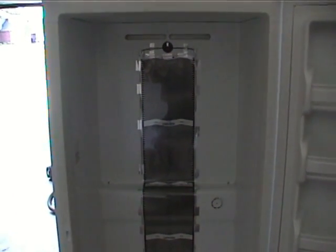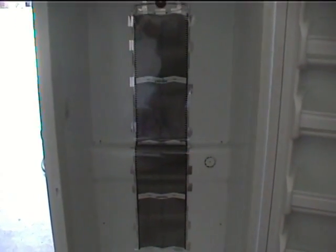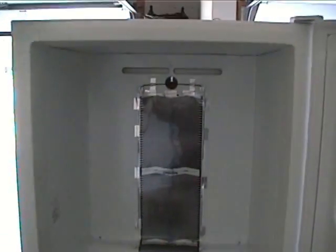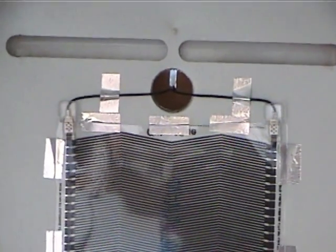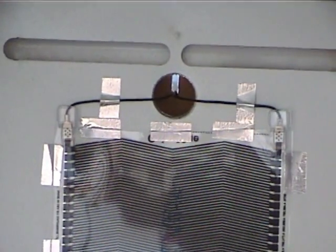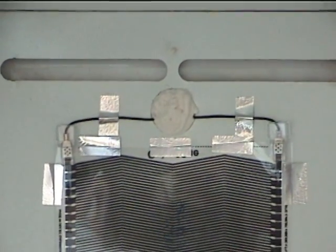I used small pieces of aluminum foil tape running up along the edges. Don't get carried away with the aluminum foil tape because if you ever have to remove the heat tape, small pieces make it easier. I basically contoured it to the back of the freezer. On the hole, I made a little template and taped it to the back to hold the cord in the center. Then I'm going to fill it with expanding foam, shave it down, and it'll be just like new.